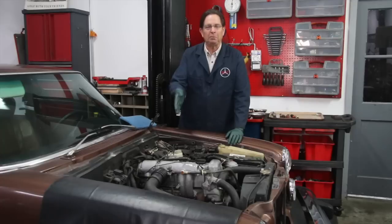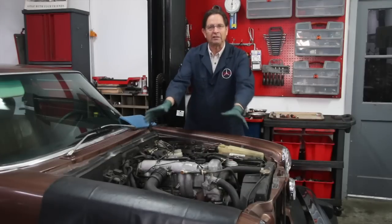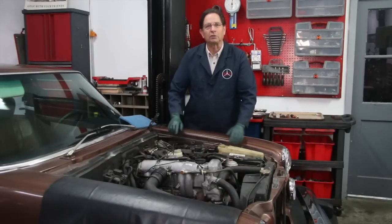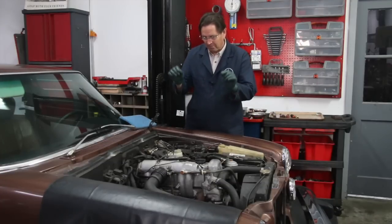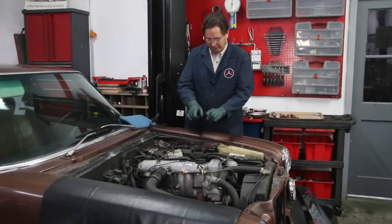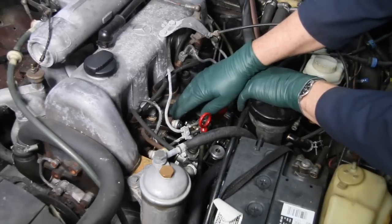To begin, I'm going to have to remove the fuel injectors and the glow plugs so I get good access in and around this engine. Yes, the fuel injectors are rusty and the glow plugs are rusty, and there's a lot of corrosion on the valve cover. So I'm going to go ahead and pull the valve cover and do a valve adjustment. While I'm doing all this detailing, I'm basically going to remove the fuel injectors, put them on the bench tester, test them — if they're not okay, I'll rebuild them. I'm going to install the fast glow upgrades on this so I don't have to worry about cleaning up those rusty glow plugs.